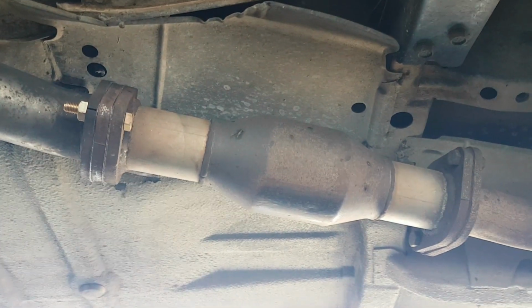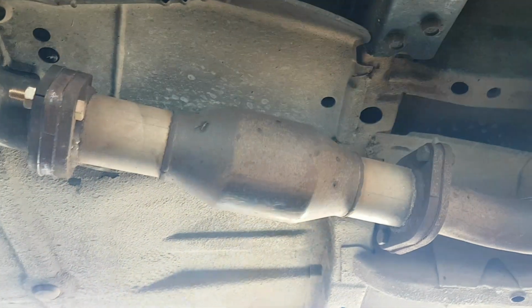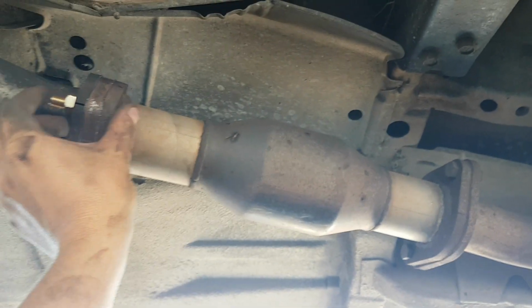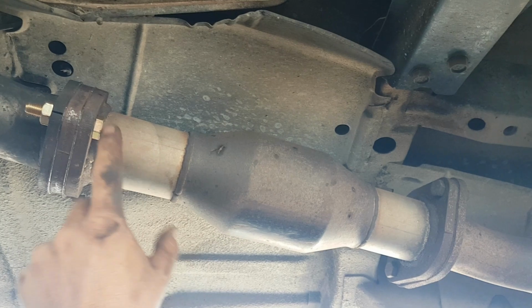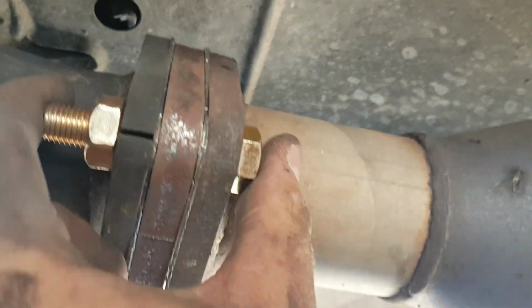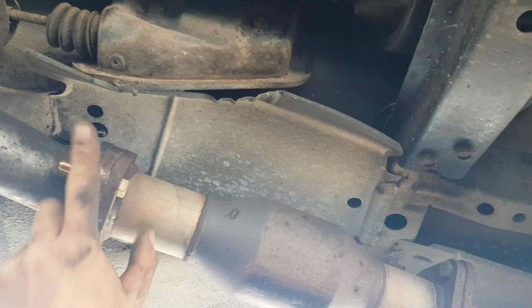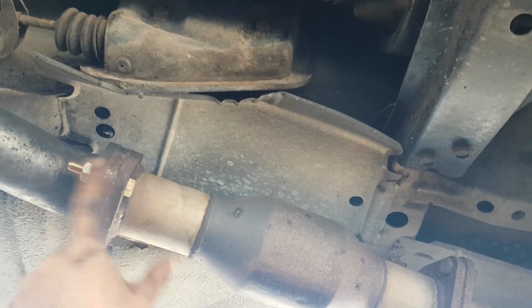So I just realized I can actually show you the exhaust and what I'm doing. So I'm under the trailer at the moment and the VN's above me. So I've just undone these 2 bolts here behind the cat and slipped in that flange I just welded with a gasket either side, bolted it back together. So these are new bolts that are a bit longer, so I wasn't sure if the stock ones were going to reach. So there's 50mm or 60mm.